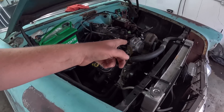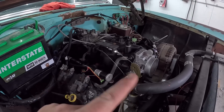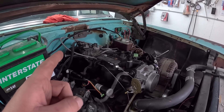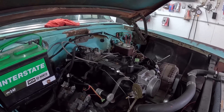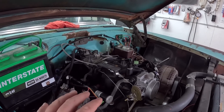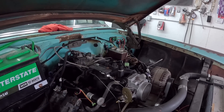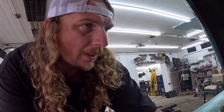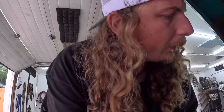We've got to figure out some sort of an air intake. The throttle is very stiff — I don't know if that's the cable or the pedal; we have to address that. Battery cables and all that sort of stuff. Oh, there's no charge system whatsoever on this, which has been an issue since day one of putting this in. These LS motors are really like 12 volts, so if you could charge it, it would run good, but then it acts funny. I would like to eliminate all that. Looks like you've got a bunch of good grounds on this thing though — someone did a good job at one point.